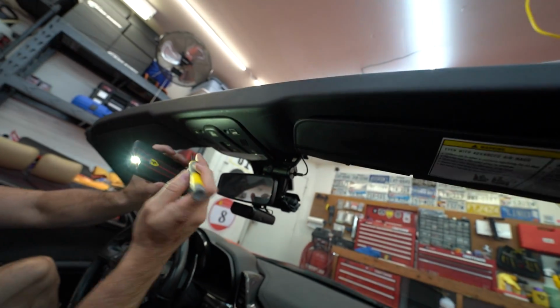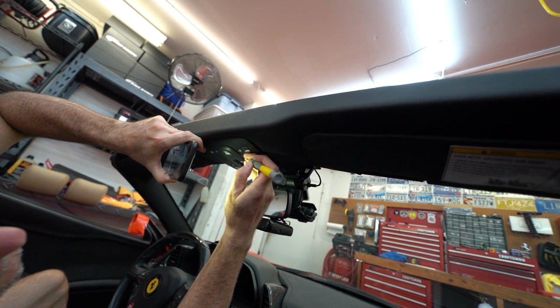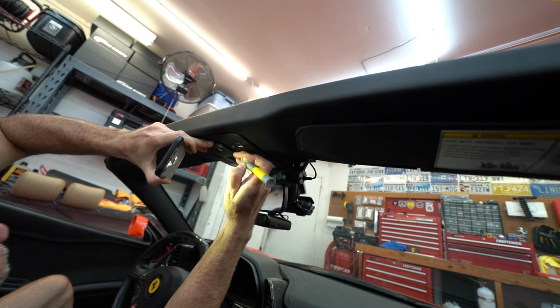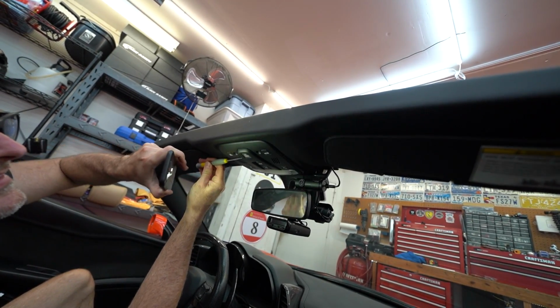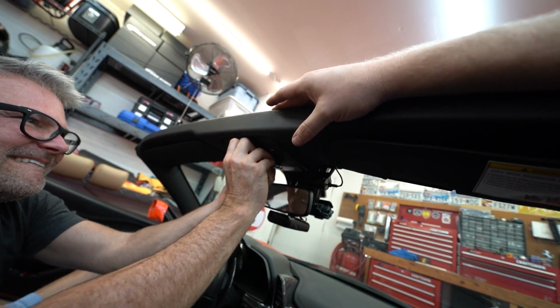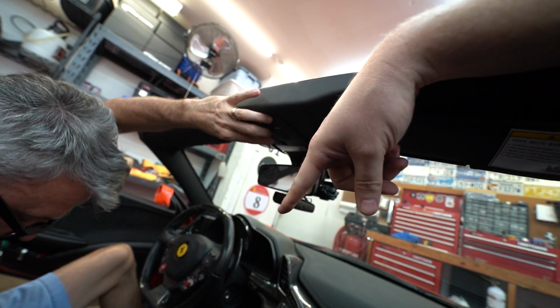Popping off this trim piece, in order to get it, there are tiny little holes on the sides. You pry, and do it gently, and the whole thing, that centerpiece, almost had it. I'm gonna have to get 2 screwdrivers, maybe do one on each side. Yeah, there it goes. You kind of gotta depress it. There's a little tab, push in on this with a screwdriver.